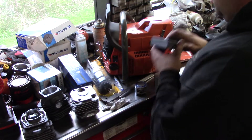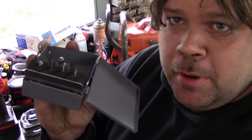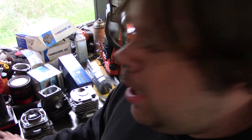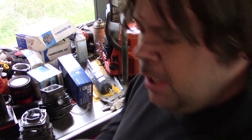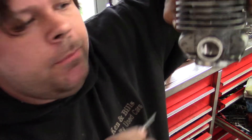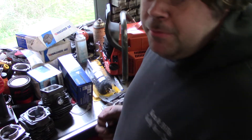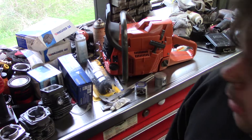Use one of them tile cutting bits — let me show you. This is what I use now, these grinding bits — this Dremel tile cutting bit. Roughs it up real rough. Just go in there, make sure it's right. Just wherever you're putting that epoxy, you want to rough that up with this. Don't wash it with nothing, just rough it up. And the same thing with the cases — make sure you clean all the paint off with this, and it'll stick. Rough it up, let it sit for a day, and it should be ready to grind.